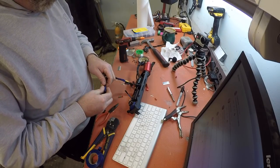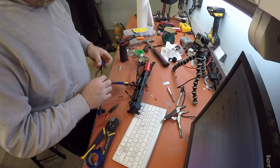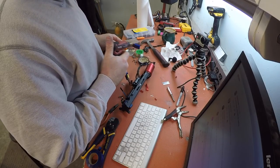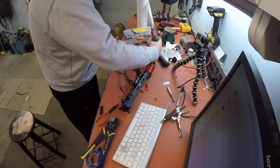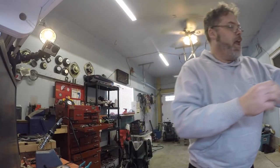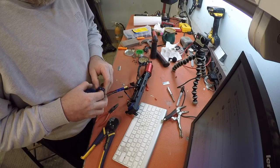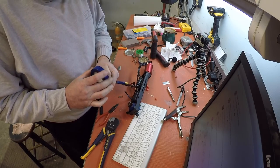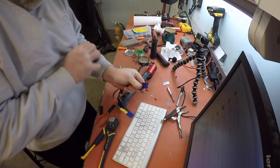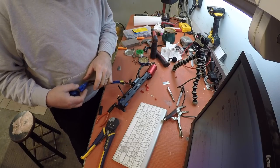There's one boys — there's one heat shrink on. I'll slide another one over top of this one, heat it up, then slide this one over like this and put this one on, slide it down, then put the next one over and heat her up again. The reason why I'm doing this is because I'm gonna make these connections up really decent, because I'm sick and tired of having issues here. Now that that's done, I gotta clean my hands off. I'm gonna start by getting around the old tape, and then when I've done this I'm gonna go out and get some big ass heat shrink to heat shrink the connections properly — so that way if the solder does get hot, they can't pull out. I'm gonna need some real big heat shrink to get over all of that.